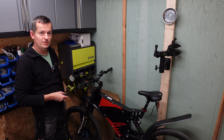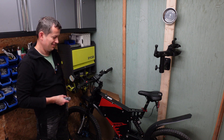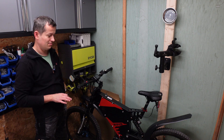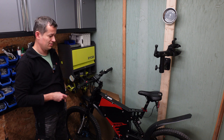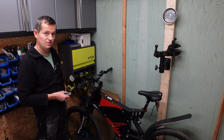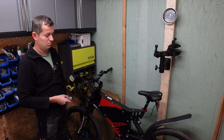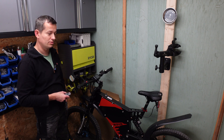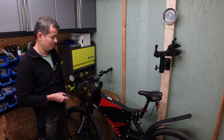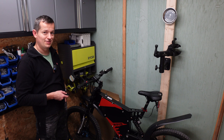I took this bike for testing with the new sprocket. The acceleration is way better than I expected — I can reach top speed in about four or five seconds, with a max speed of around 50 km/h. This bike was built for hard terrain in the mountains and forest, so torque is the most important thing. If you're considering installing this type of sprocket, I think it's a good idea — especially if you're riding on the throttle. If you're using pedal assist, it's better to stay with a normal cassette and gearing system. That's all for today — thanks for watching, take care and see you in the next one.